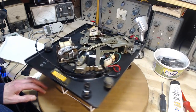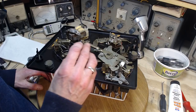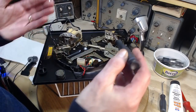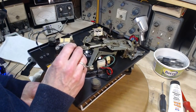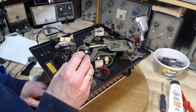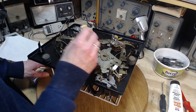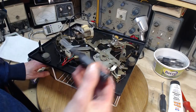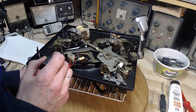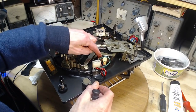Now it's flipped over — what do we see here? This looks incredibly dry in here. This looks really dry all through here — dry, shrunken up, gone flat, no life. I see lots of grease spread through here. You want to take note of these greased areas. It's a large greased area here and a large one in here. Because what happens is I clean up all the old grease and I can't remember where everything was. But it's pretty simple — wherever there is metal chafing on metal, you want grease under there.